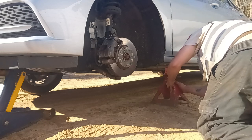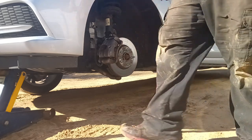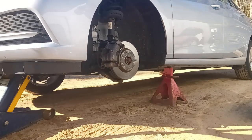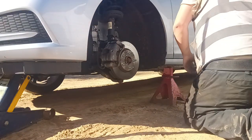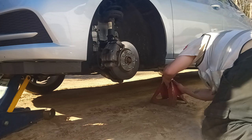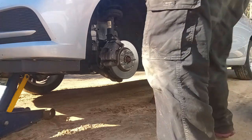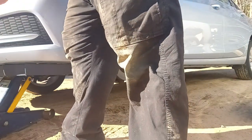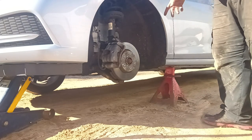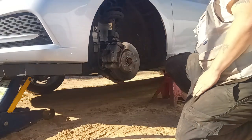Got to make sure it drops in the groove. There's a groove underneath here for just this reason. Can you pump that just a little bit? Perfect. Now we're in that little notch there. In this car, an engineer was thinking about that — the jack's not going to raise it up high enough, so we need a notch in there so they can get a jack stand underneath it. Smart.